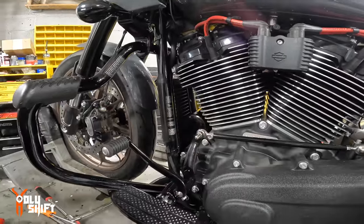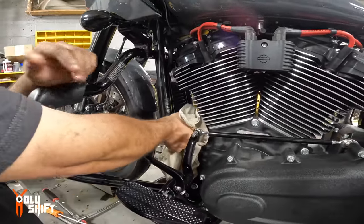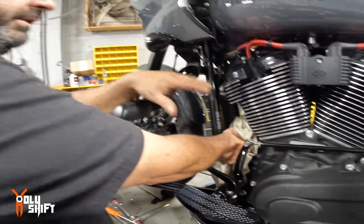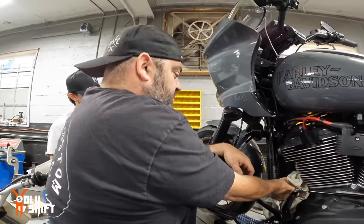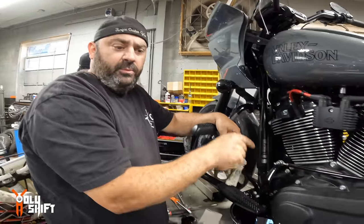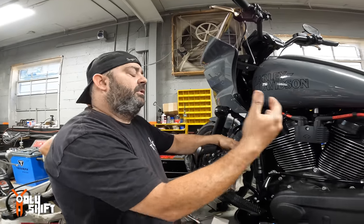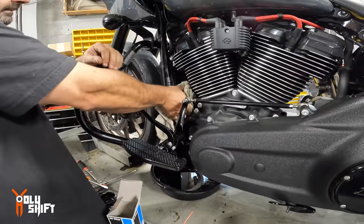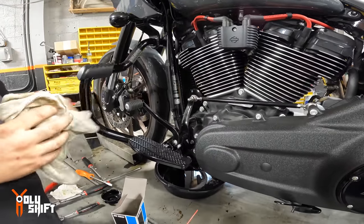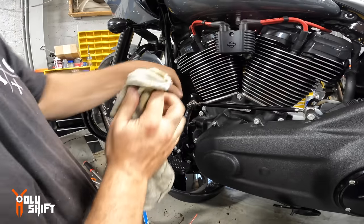And it's a lot easier to check the oil level and get it right when the filter's already filled. Gotcha. Because after we put the oil in, we're going to start the bike up, let it pressurize the system, then shut it down. We're going to check again and have to top the oil off. And when you put these on, just hand tight. You don't need a wrench.